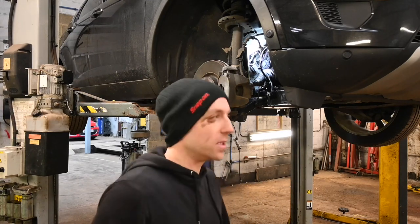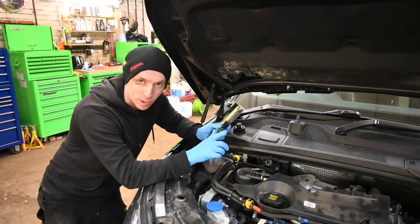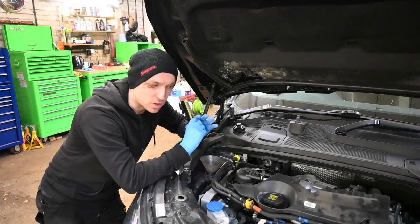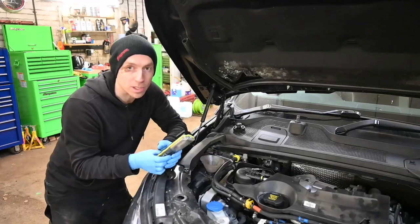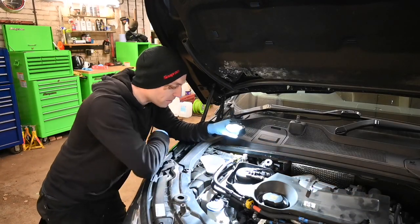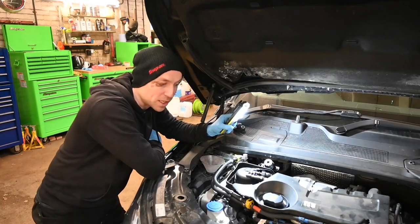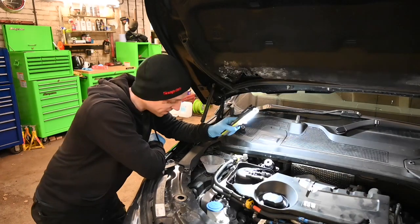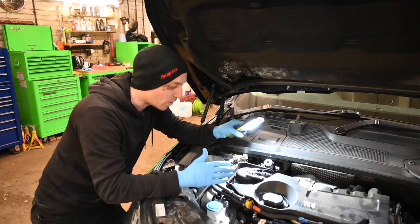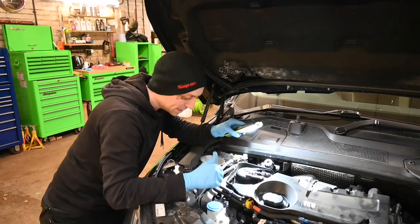Off-screen I've put the wheel arch liner and wheel back on and got the vehicle off the ramp. I had the vehicle up in the air running and can't see any obvious leaks — so that is a fix. I've topped up the coolant — over in the corner is your coolant reservoir. With Land Rovers, these engines take red coolant or red antifreeze, so make sure you buy the correct one. Make sure it's either pre-diluted so you can pour it straight in, or if it's concentrate, mix it 50/50 with water. Fill it up to the maximum mark — you'll probably hear some bubbling or gurgling as the system lets air out naturally. Keep topping it up until it stops draining down and sits at maximum.